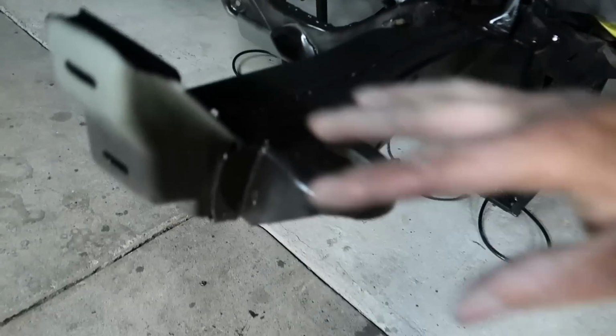Just doing a really quick introductory coat. In a situation like this, there's a lot of different angles, up, down, inside and out. It's really easy to get a run in places if you just full send and put a wet coat on there right at first. So what I like to do is spray into all the hard to reach areas, all the crevices, and then just do a quick once over. You're kind of misting it. You're not even covering the whole thing, so you can still see primer in areas.